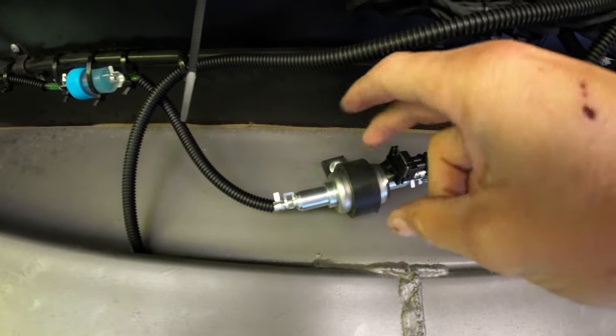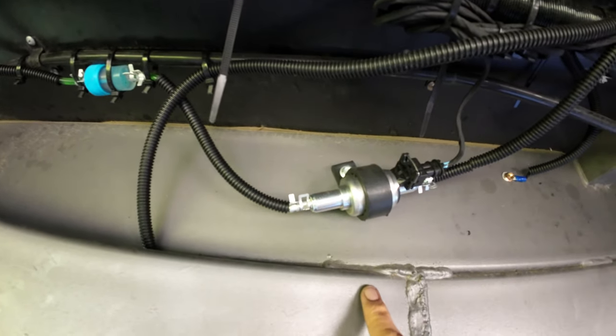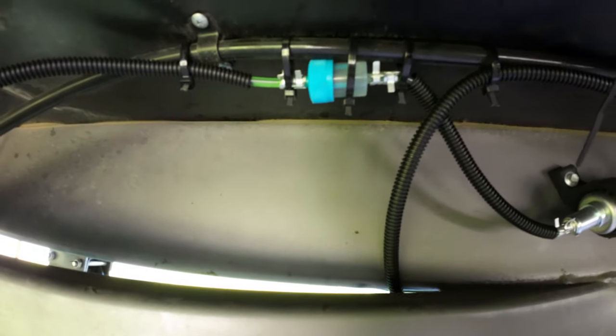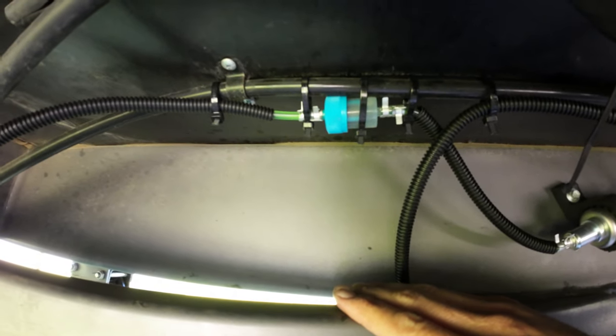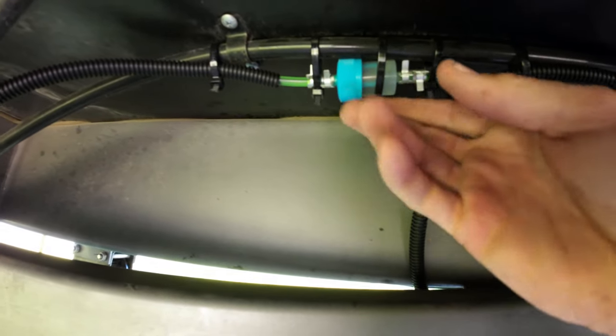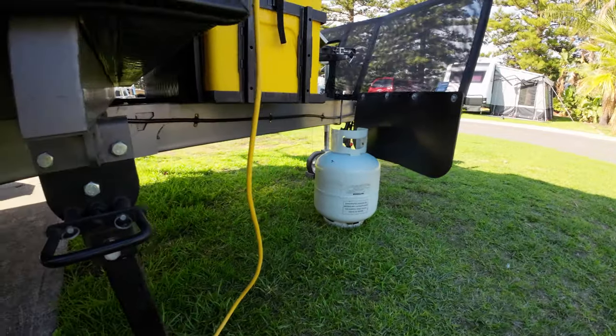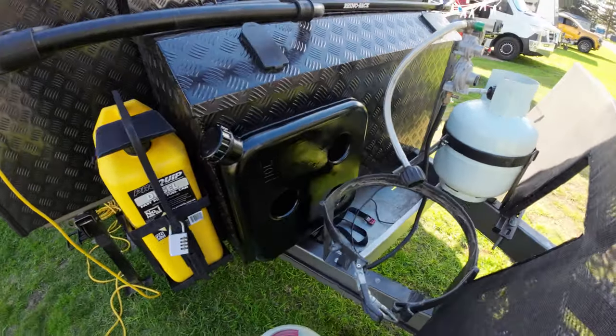The fuel pump needs to be installed at a 15 to 30 degree angle — make sure you do that, it's pretty important so it doesn't suck air. And then there's a little fuel filter, just cable tied straight to the pipe. I try to use cable ties rather than putting in more screws and saddles — way easier. The fuel line runs through the tray at the front and comes out up into the bottom of the diesel tank I installed on the front. That's it, mate — pretty simple.